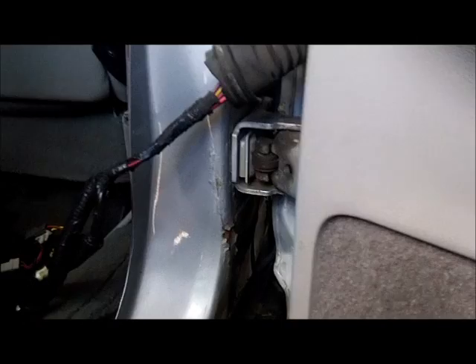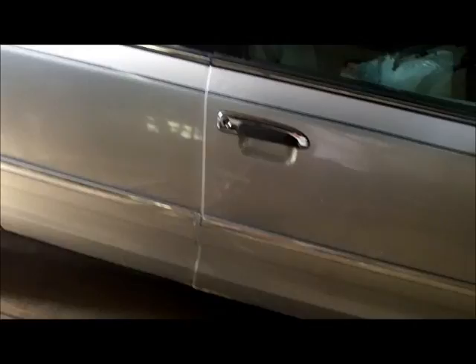So we're going to call that the end of part five. Door hinge didn't fix anything. Video six, we'll be figuring out what we've got to do to get these doors where they belong. The reason why these gaps are so tight: when you push in on an area like this, it's actually shrinking everything — shrinking the gap from one side to the other. The car is actually shorter from that door line to that door line because it's pushed in here. So we need to pull it out so it actually makes that door gap wider. That's pretty much all it's holding us up from doing our final body work and paint. We'll continue on six pretty soon. Later.